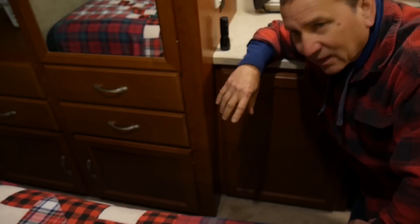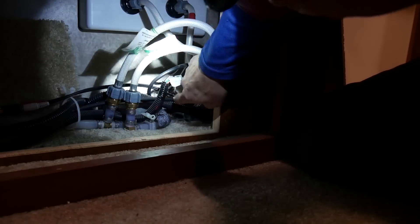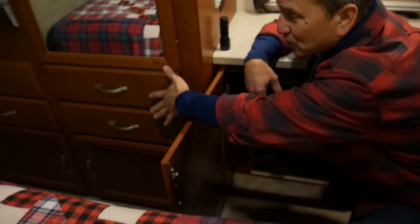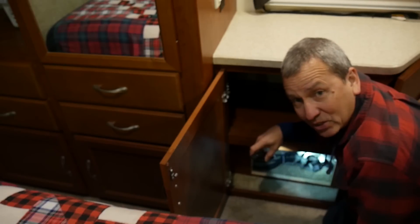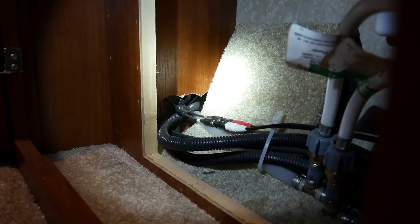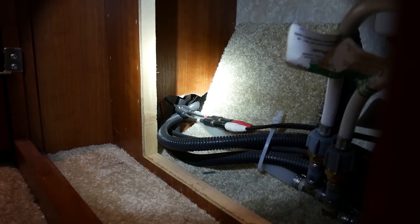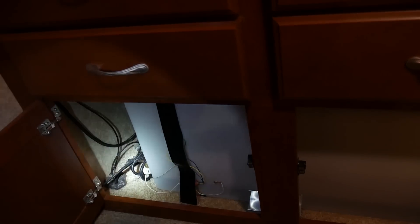Let me show you roughly where I know I can bring the cable into the RV through the floor. I know there's a spot near my sewer bay that I can run the cable up in through that hole. There's some existing wiring and some tubing that comes out from that point, and that point enters the RV through here. Now I've already removed a panel. This is kind of the cabinets in the rear part of the bedroom — there's a closet here, some drawers. There's already some existing wiring here and my water lines run through here, so this is where I'm going to start bringing the cable in. The wires that are already there run through this hole, which heads through the wall of the cabinet and goes right into the compartment where my water tank is. I can run the cable behind the water tank — you can tell it spans this whole area — and behind it I can get to the water pump where there's some existing wiring.